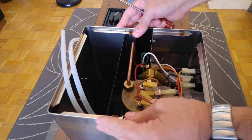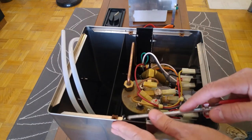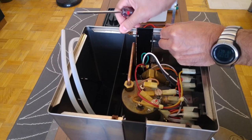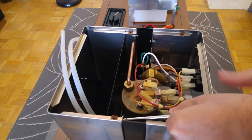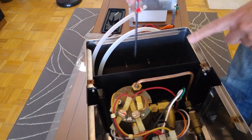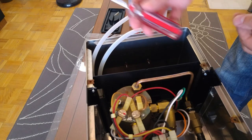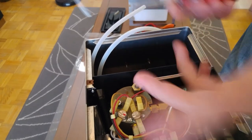For the back cover, you have three screws — two here holding the back cover to the frame. You just need to loosen them, don't unscrew completely. The other one is down there under the black metal plate; it has a cut for the screwdriver, but best case is to have a long Phillips screwdriver.